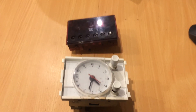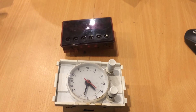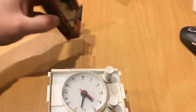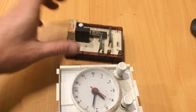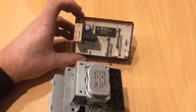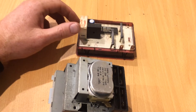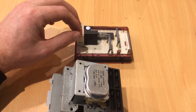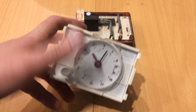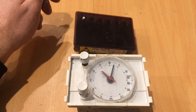If you've got an appliance technician or an electrician doing work on your oven — and I especially recommend this in rentals or places where a lot of different people use an oven who may not be familiar with it — you can actually bypass the clock. Talk to the electrician and they'll do it. Basically on some of these clocks it's a relay, and on the old mechanical clocks it's mechanical switches. They can change the wiring: either take the wire that runs to the clock and then onto the thermostat and run it directly to the thermostat, or bridge and jumper them onto the relay so the switch or relay isn't actually doing anything. That way you can have the clock flashing away at zero, zero, zero to its heart's content and the oven will still continue working fine.